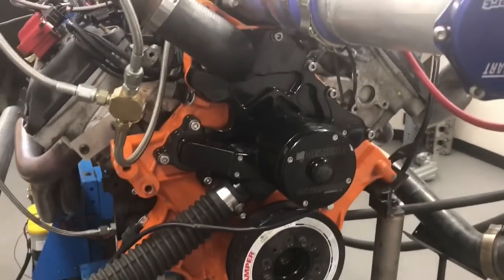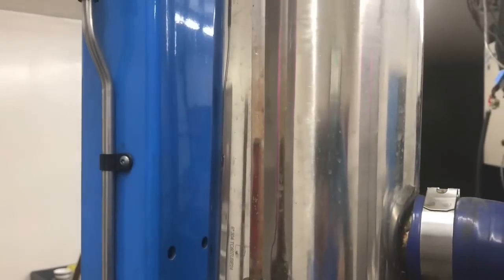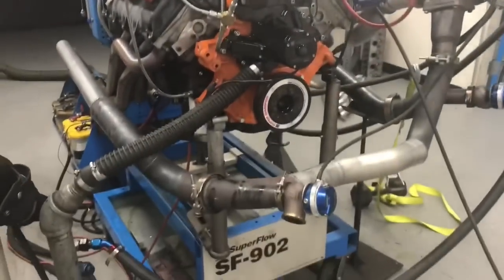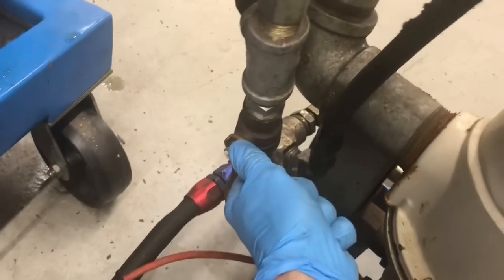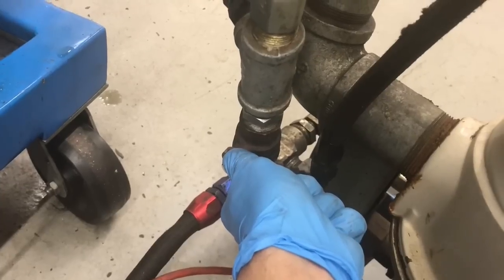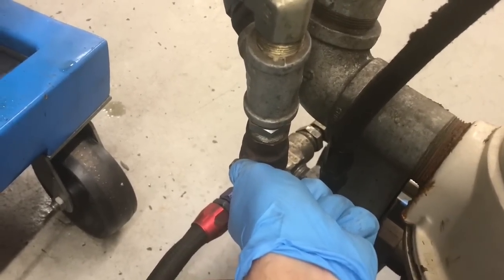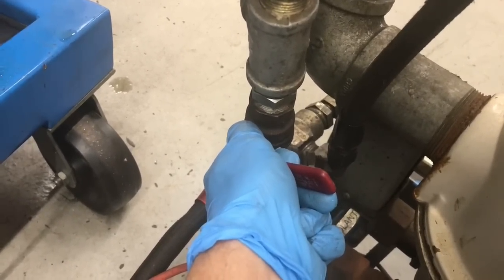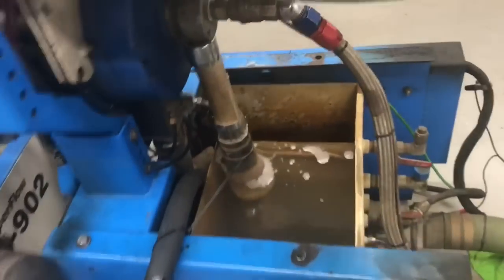The water line going into the pump. Gonna come out. We'll know when it's full. We got a little sight glass here that fills up all the way. Okay, down here, we got a little valve. I'm going to open that up. You get water flow through the intercooler. Your line's going up through here, up into our air water core, out over here. We can check the flow rate.